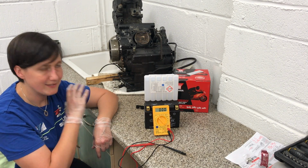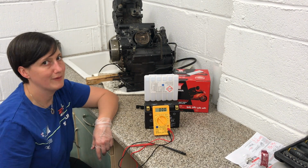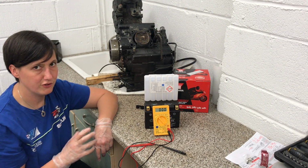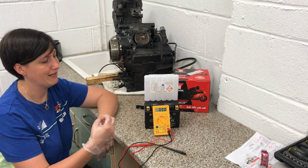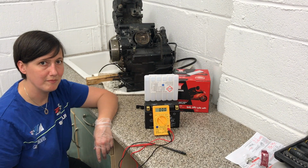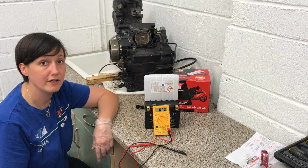It would be disastrous to use the battery now. It would do the battery and the long-term lifespan of the battery a lot of damage to use it. What we're going to do is let the solution settle, and then we're going to put it on a slow charge. So again, that very first charge, it's important to invest that time, because you'll find that the lifespan of your battery lasts so much longer.